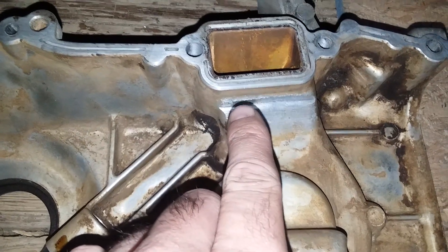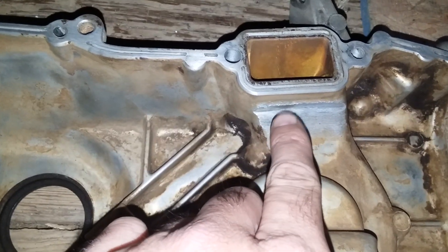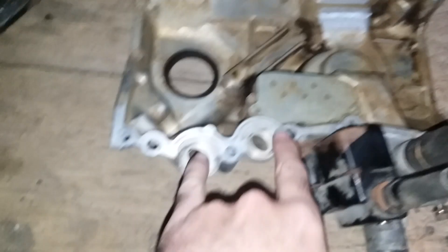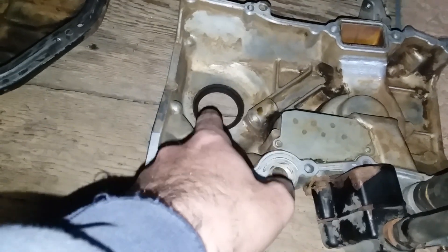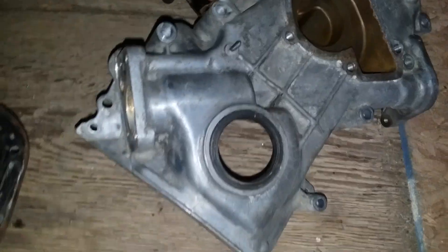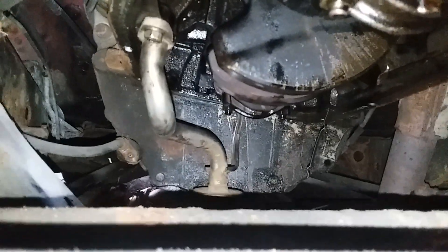You've got to watch out for that. This one is not all the way through the metal — there's still a decent amount of meat here, so I'm going to put this back into service. Also, remember when you're doing your timing chain, replace these gaskets here and the front main seal. This is a good time to do the front main seal, which I did get in a kit.